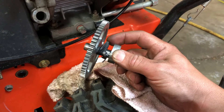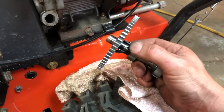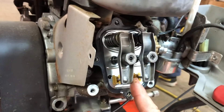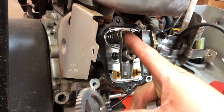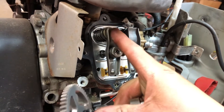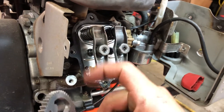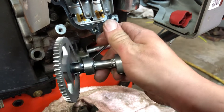I'm expecting when we pull this apart, we're going to see an issue here. Otherwise, we would see this portion of the camshaft lifting up the push rod right here, which we're not seeing. Now, if I saw way too much valve lash here — like 35 or 40 thousandths of an inch, which this doesn't have — that might actually be what was causing the problem. But instead, I think the problem is the camshaft itself.